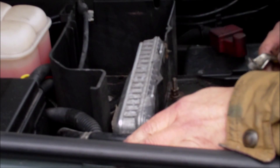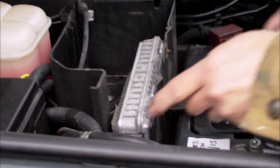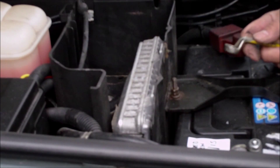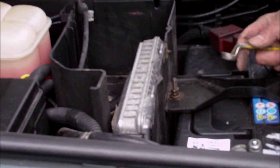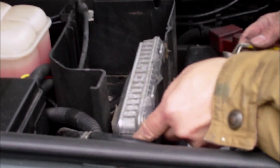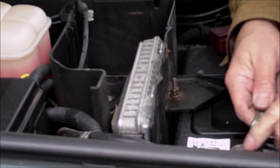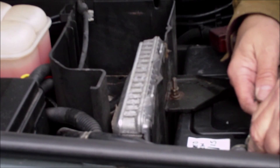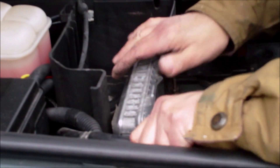You can see how quick that was. That's the check to see if there's oil in the injector harness coming down into the ECU if you've got problems with your XYZ switch. Next I'm going to get underneath and trace the wiring from the XYZ gear selector unit, trace it back to see if it's chafing on the top of the gearbox on the alloy casting. I'm quite satisfied there's no shorting in the ECU and the signal can get through. Next I'm going to check the BCU body control unit, which is located under the passenger seat at the front.